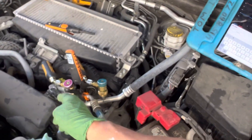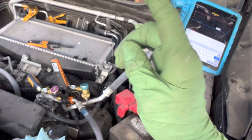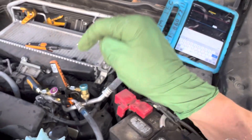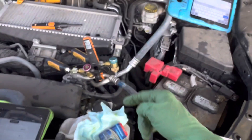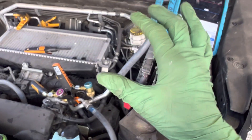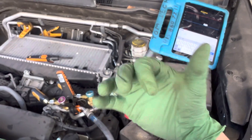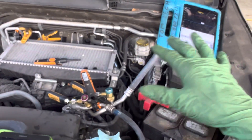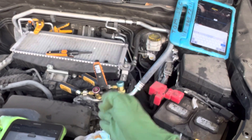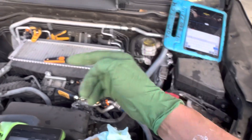You have to understand that you have a computer, a brain taking over, doing some stuff that you'll call voodoo magic — funny stuff is going on. If you were used to fixed piston compressors, I'm telling you, you will get fooled. I see guys overcharging and undercharging vehicles all the time, burning up compressors, roasting clutches — this one doesn't have a clutch — because they're using their old school knowledge. That starts going into the garbage can now; it's a new set of rules. This is why I'm seeing in automotive shops so many burnt-up compressors — it's from the old school guys, the guys with a lot of experience — they're the ones causing the damage, on top of the guys with no experience.